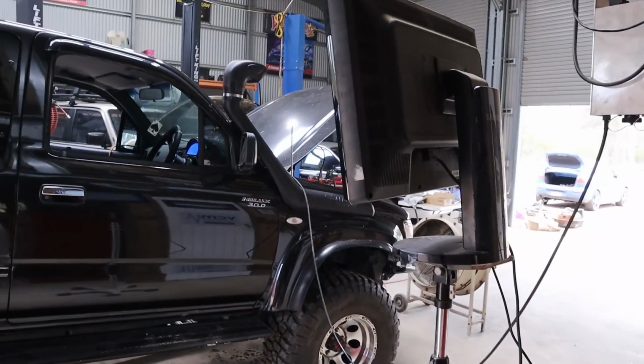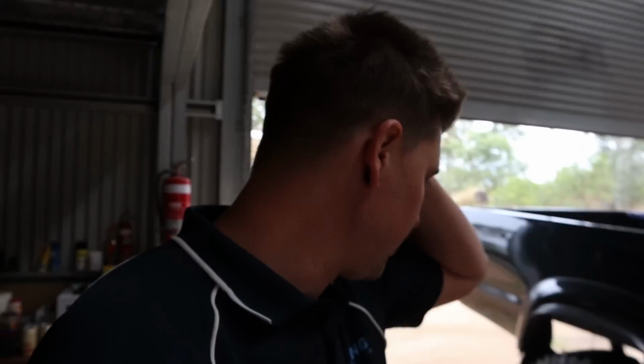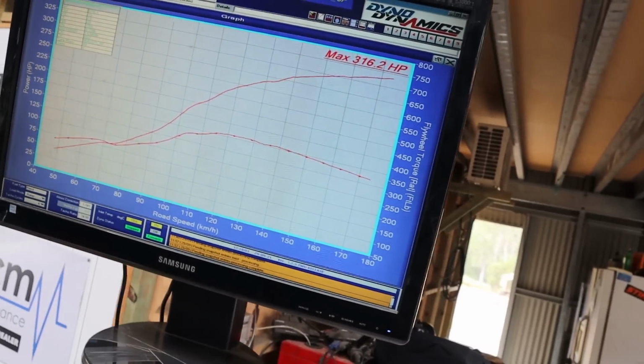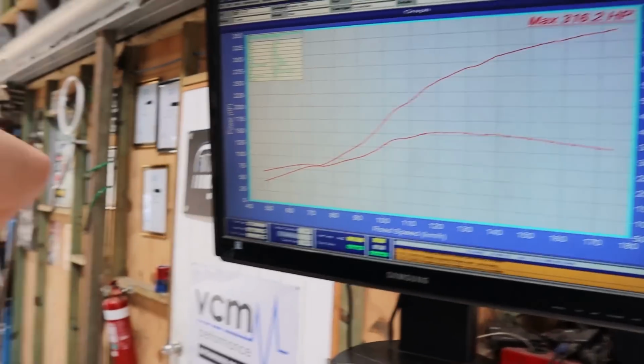So that's pretty much the end of the Hilux. That's the big girl. So after all this time being broken, off the road, all this stuff happening, she's finally got a new exhaust and she's sorted out and finally tuned, and decent hot side. This turbo's not doing too bad. It's coming on 3000 RPMs when it's really still sort of coming on, which for a T4 footprinted turbo, I'm pretty impressed with. I definitely reckon that you couldn't get much better as far as a T4 turbo goes for this thing, so stoked with that.